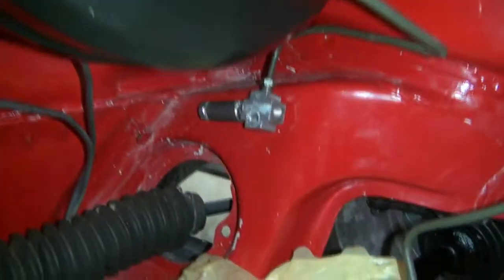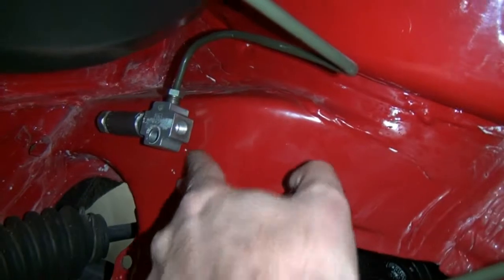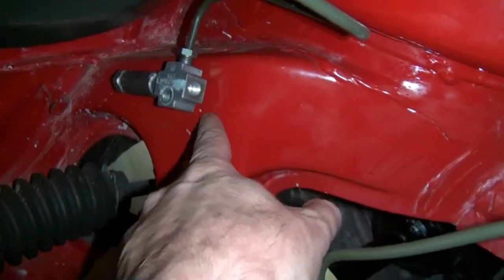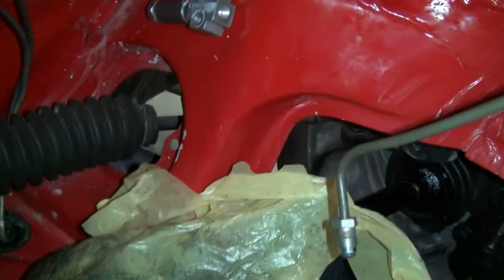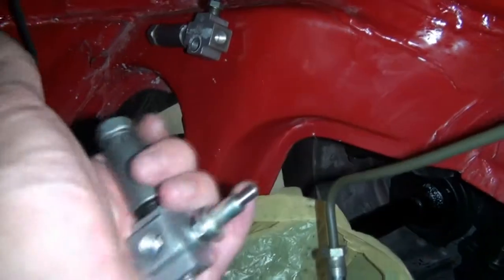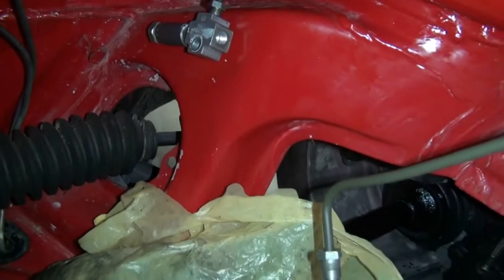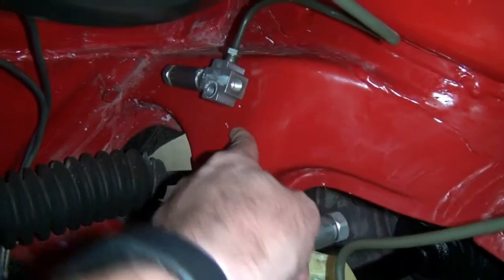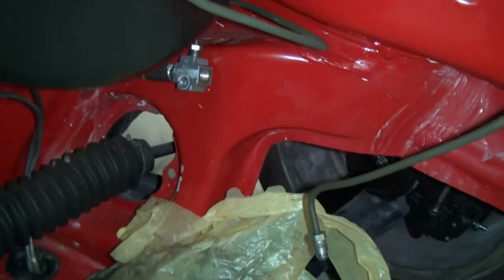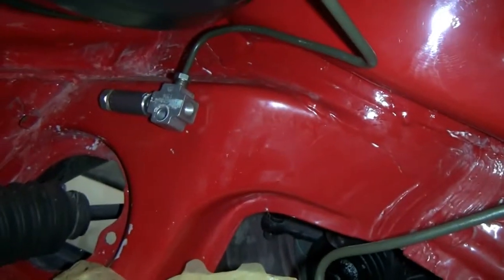I started mocking up - you can't see it in this light, I'll see if the camera light will show it. Basically these marks here, I used a punch to mark where I need to drill so I can do a pilot hole, and I need to expand these out in order to get the rib nut in before I can use the insertion tool and create a captive nut in the lower part of the wing.